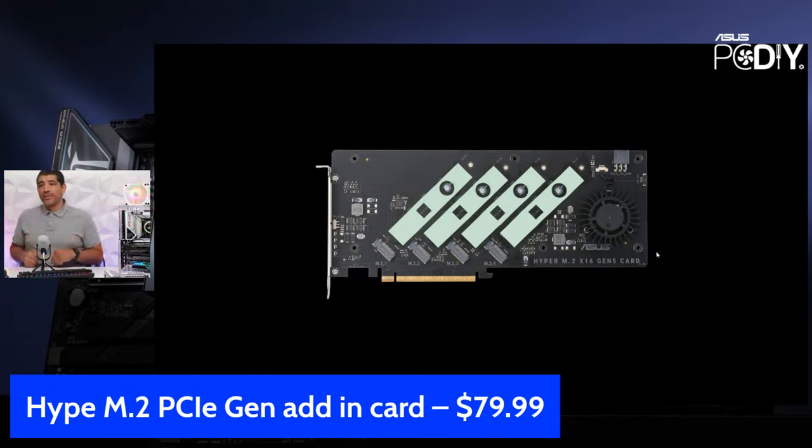So if the motherboard cannot actually send that, it won't be able to correctly utilize all the slots. Now, most of our current generation motherboards will generally support PCIe bifurcation. We do have an FAQ document on our service and support website that notes the models. There also may be a requirement that you toggle something within the UEFI BIOS to enable this function, but you do want to keep that in mind, okay?